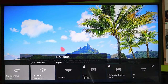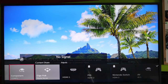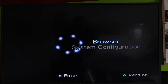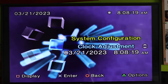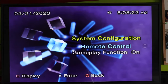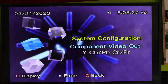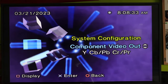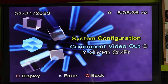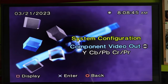Before you turn on your PlayStation 2, make sure you switch from the AV input setting to the component input setting. Here is the PlayStation 2 with the component cable on a modern TV — everything looks way more clean and crisp with sharper edges. You have to make sure you have it on the right input setting on your TV, otherwise your screen will be black and white. Make sure you have it on the component setting on your TV and the correct video out setting.